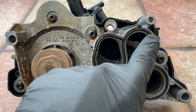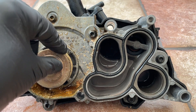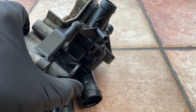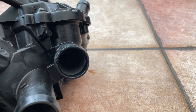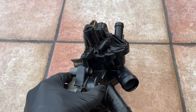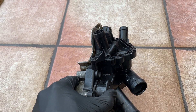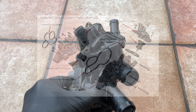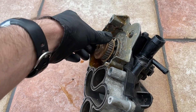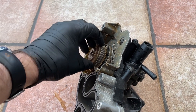I thought it might have been leaking from the O-rings here, but it's obviously leaked from inside this impeller. I wanted to open this up and have a look because it's quite a complicated beast. It sits on the other side to the regular place for coolant pumps - they're normally on the timing belt. For the 1.4 TSI engine, 2014, it actually lives on the other side, driven by a belt from the exhaust pulley, via the exhaust camshaft.